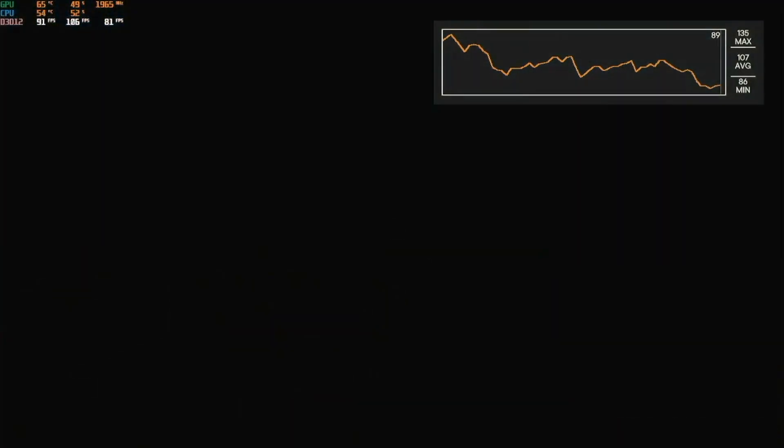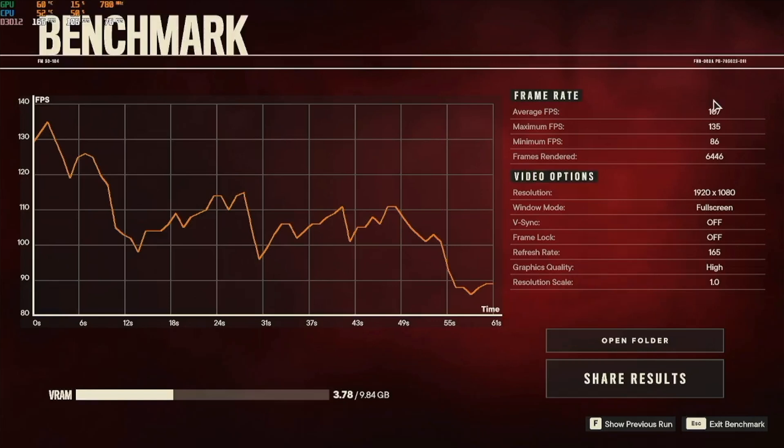It looks like about 107. Not too bad. So let's go into BIOS real quick. I don't know how many of you have seen the video on overclocking the non-K chips, but I don't see the option to raise the base clock. Unfortunately, that means for the 12400F on the B660 ITX ASUS board, it doesn't look like you can overclock it that way. But that doesn't mean we can't go and tune our memory a little bit.